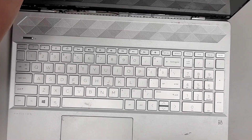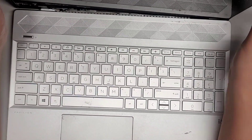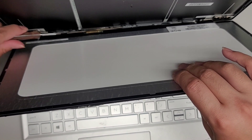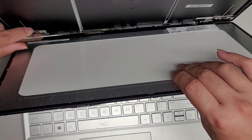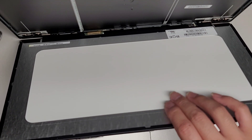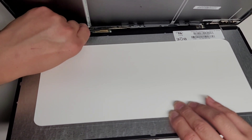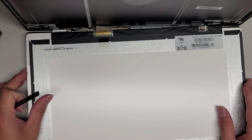Let's go ahead and replace the screen now. I already took the adhesive out, so now we're just going to let the screen flop forward. It looks like they might have held the cable there with adhesive as well — that's going to be somewhat annoying. I'm going to use this tool and try to pull the screen cable out a little bit away from that adhesive. If you're doing this, be very careful because you don't want to damage this cable. Let's see if we can somehow pull this forward — I'm going to use this pick tool and try to scrape it out a little bit. Why do they put adhesive on everything? So we're just getting this adhesive out — that's about enough that we can flop this forward.